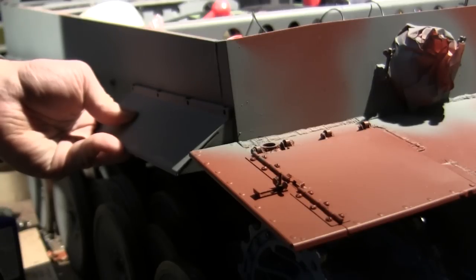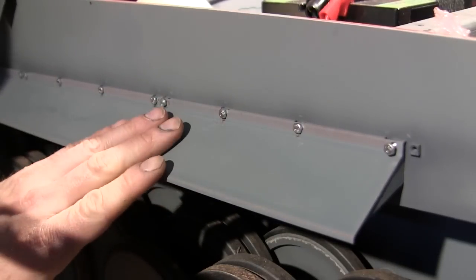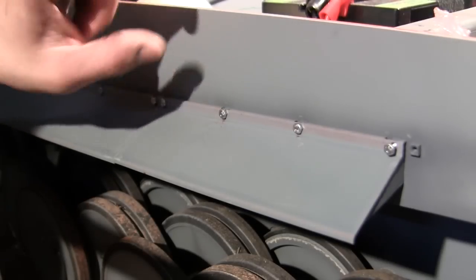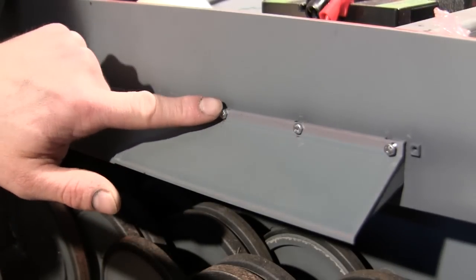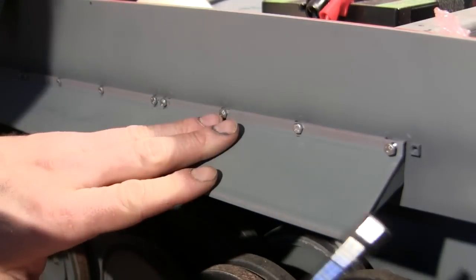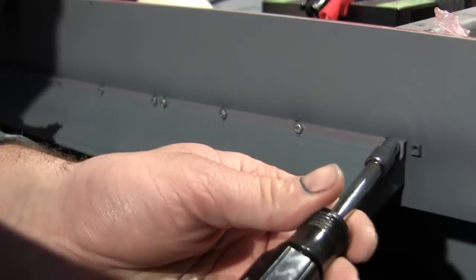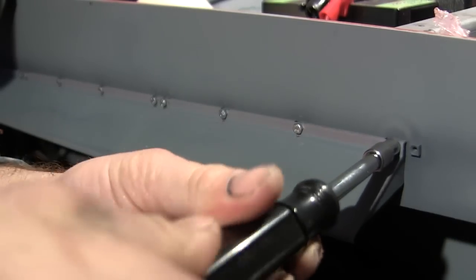During installation, when it comes time for mounting the fasteners, you don't want to over-tighten these pieces — just bolt them on until they stop turning. The reason is that the boss is only mounted to the tank via adhesives. If you over-tighten, the adhesives will buckle and the little square will spin. It's not the end of the world if that happens, but it is an inconvenience. Just bolt them on until the fastener bottoms out and leave it alone. The fender will be firmly installed, and the Loctite will prevent the fasteners from getting loose.